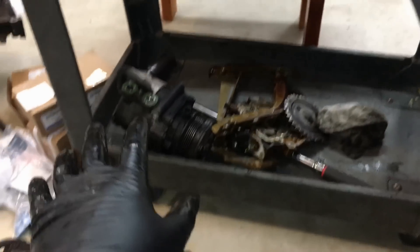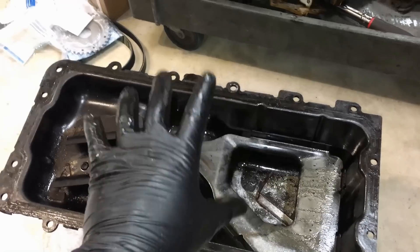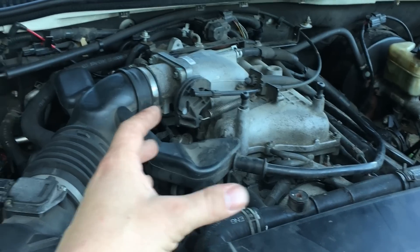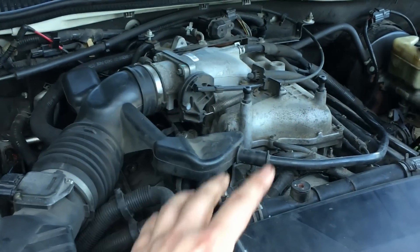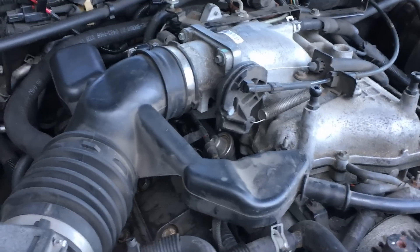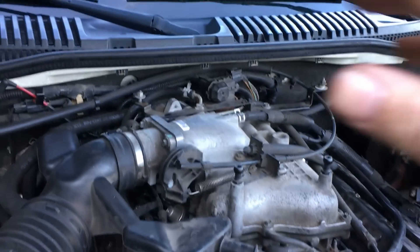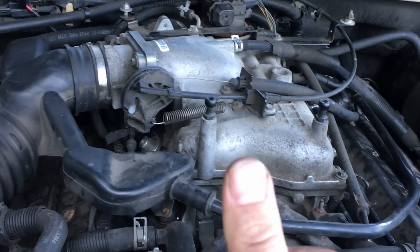I need to get back to it and start replacing all this stuff and cleaning it up. I hope this properly illustrates why, when you hear that noise, you get in there and fix it before it self-destructs and ruins your engine. I have everything back together now — 5W-30 in there, cleaned as much metal as I could out of the upper end, cleaned the pan really well, all new timing components and oil pump. Listen to it now — like a new engine. All that metal in the pan was coming from the front cover and dropping right down. It seems the rest of the engine can be saved with a thorough cleaning. See you guys next time.